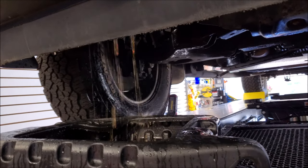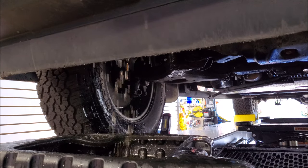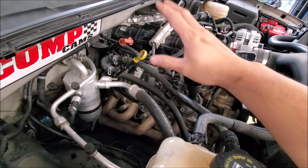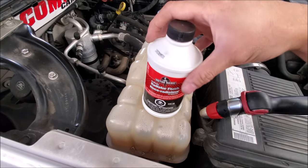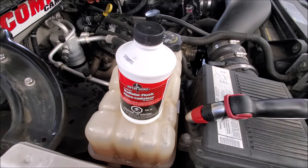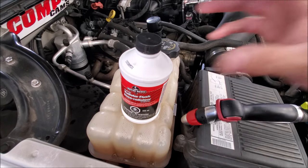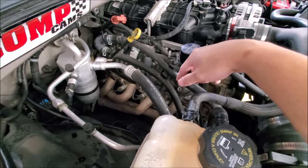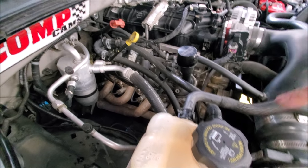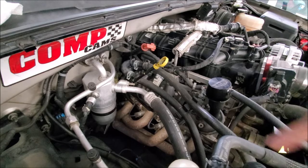Draining the coolant isn't fun on these, but I would definitely take the time and opportunity now since you have to top off the coolant when you hook up your heater core — you might as well put fresh stuff in. Because I had to do an emergency bypass to keep the truck running, I'm taking the opportunity to flush out the system. I'm running the flush for 10 minutes inside the system as per instructions, then I'll flush it and refill with water again — add water, run it for 10 minutes, drain it, let it cool down, add water again to really flush it, run for 10 minutes and drain. Then I'll hook up the new heater core lines and install the new coolant, so I'm putting all the fresh stuff through the core.